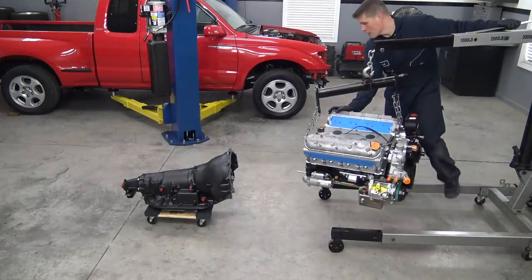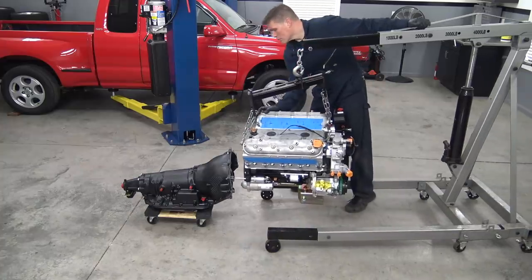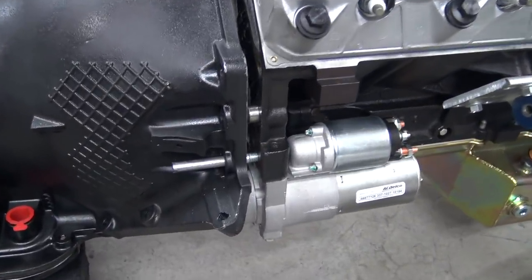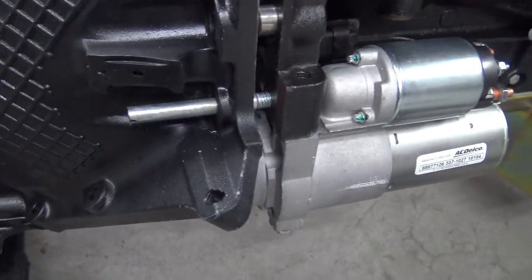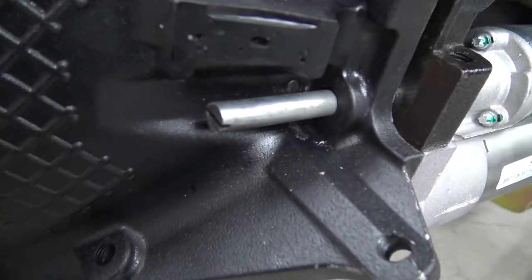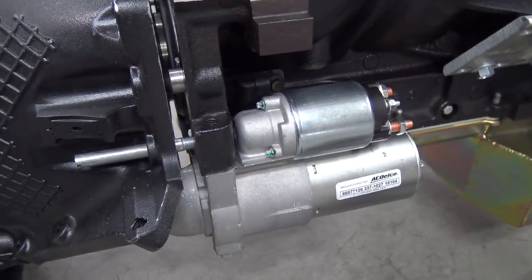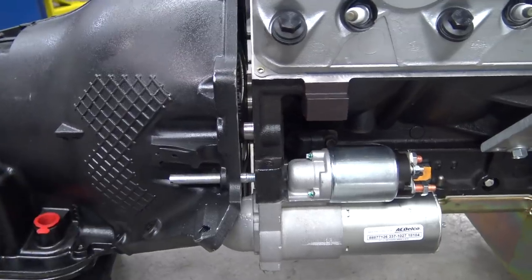It's time to join this engine and transmission for our next round of test fitting. The mating of the engine and transmission is coming along great so far. I used this tip from LS1 Tech — take a long bolt, cut the head off, put a slot in it so you can use a flathead screwdriver. Screw it in as a guide pin on both sides — it's really handy and a good visual guide to help line everything up. Converter spins good.